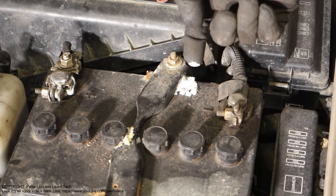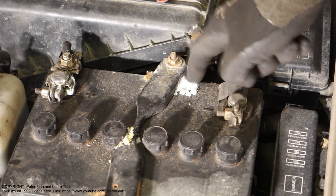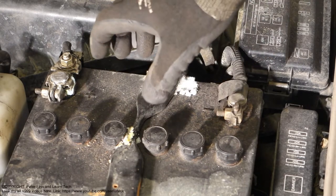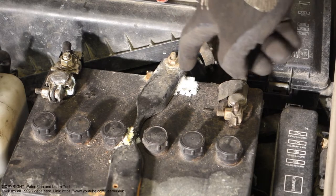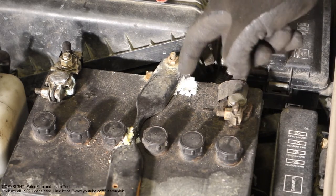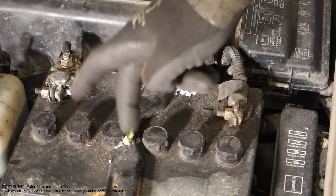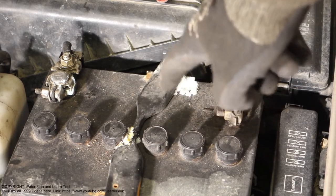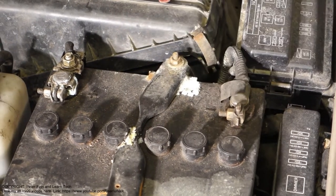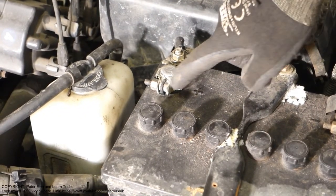It is like cancer, when we have cancer in our human body. This is a similar bad thing, because it spreads out and always expands. I check that here is this white material, and within a couple of months it is also in that terminal area and in here and here. And now when we check, there is also corrosion in here and in that terminal base, the plus area, there is this white corrosion.